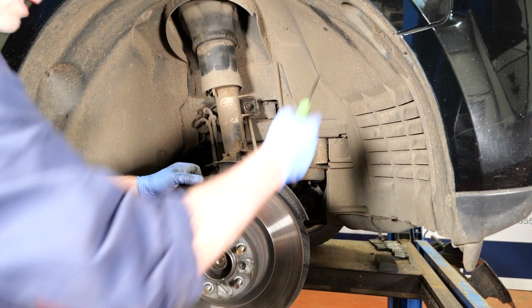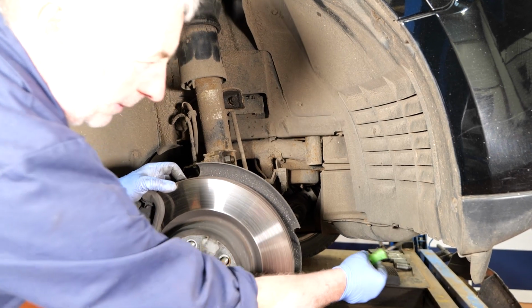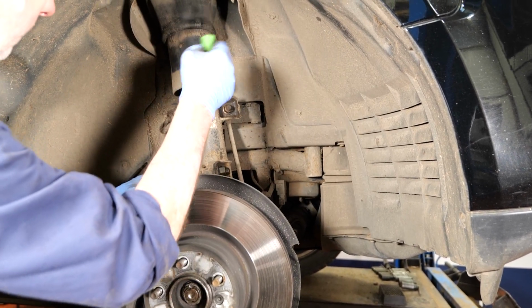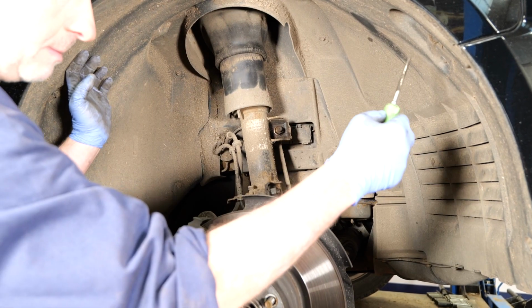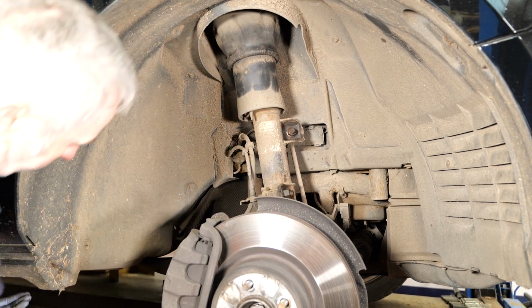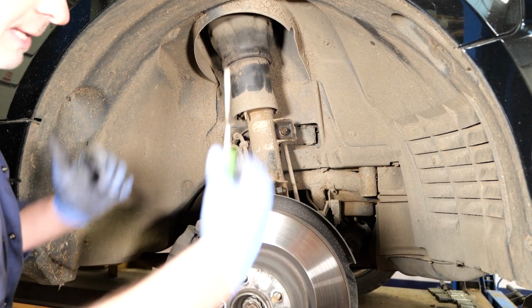The inner wheel arch liner has to be removed, as I said earlier. Now then, there are 5 clips underneath there, where you need to pull out the centre pin first, and then you can remove the clip. There are 3 10mm spanner size nuts, one here and one here. They all need to be removed, and then there are several 8mm bolts around there, and then 3 underneath the floor here. So once we've got those all removed, we can then take the liner out.